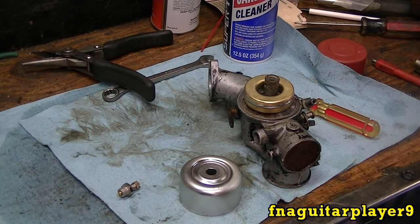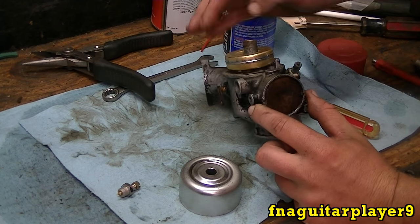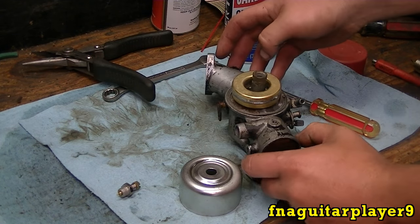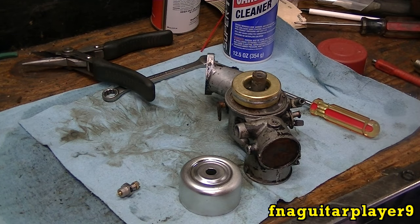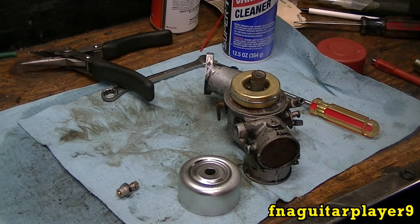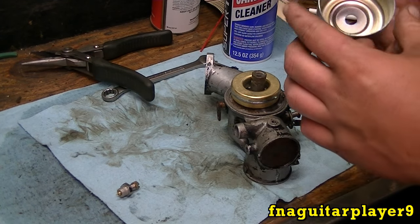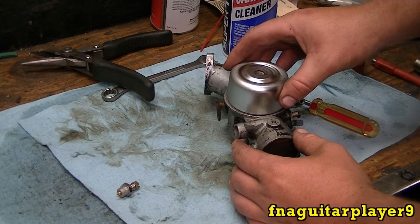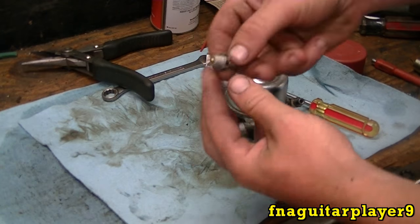If not, you have to adjust it. And this float actually should be adjusted on this. You see it's leaning towards it. But since it's sealed, I'm not going to, because this is set up for that other carburetor. I don't want to mess it up for it. So for right now, I'm just going to leave it alone. It should be all right. And you make sure your bowl's clean. In this case, it's a new one, so we know it is. Then put this one there.